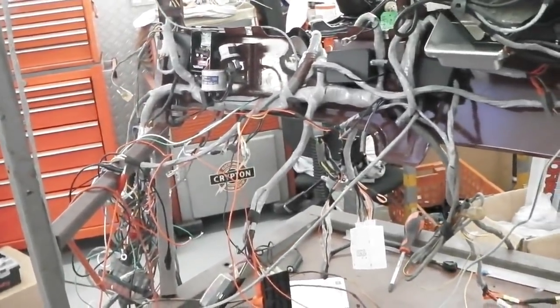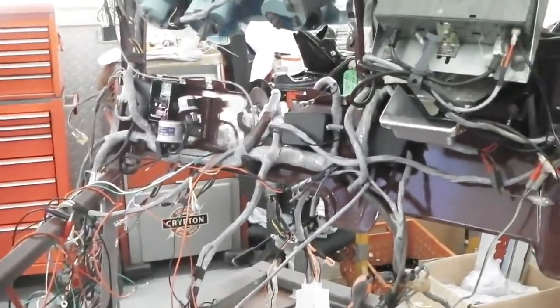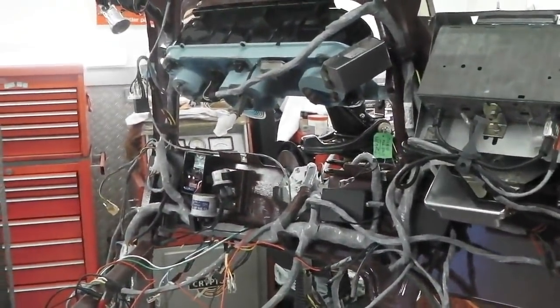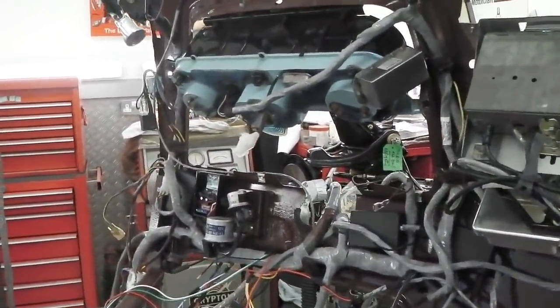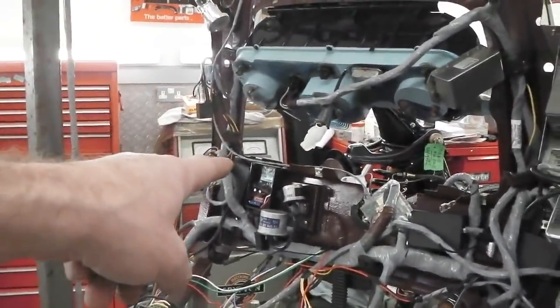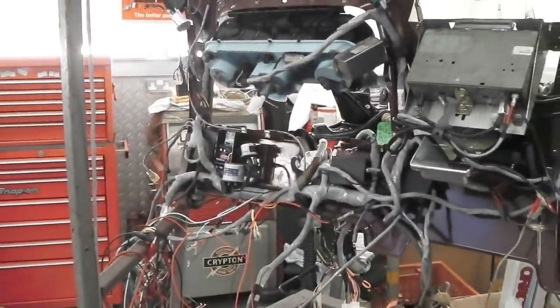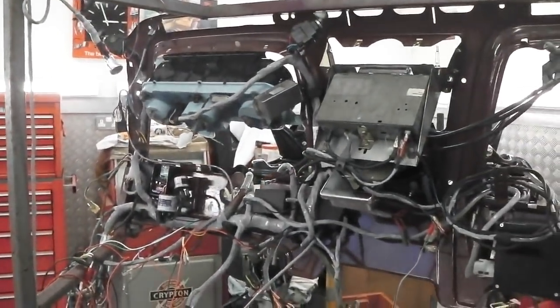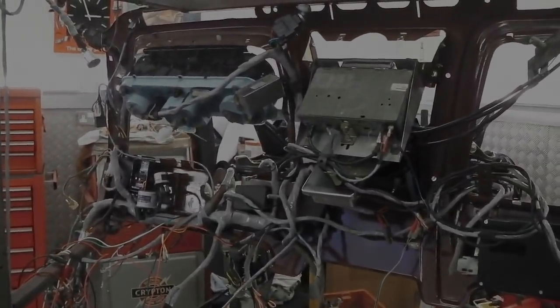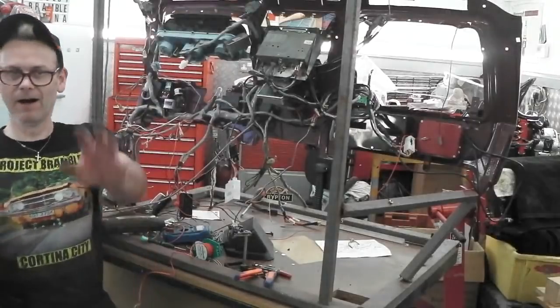I'll do them now and we'll get them running. I'll use that heated rear switch for now. So let's wire the hazards in and operate them, because they'll work without a load, you see. They don't need the load. They just run off the chip, so the chip won't even know. We should get four flashing lights now. I'll do that and we'll jump straight to it. Time warp for you, then get ready for hazards. Boom!